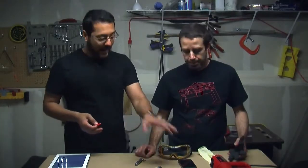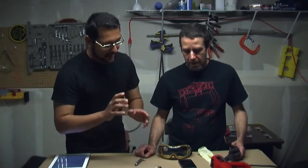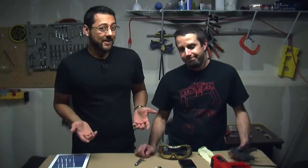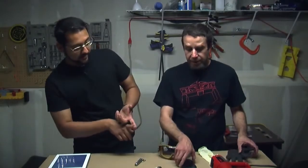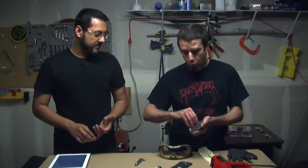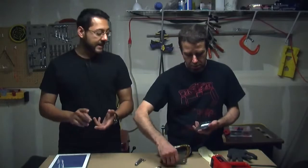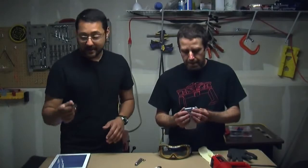If you're going to try this at home, be aware that you might destroy your phone, so back it up — we've shown how to do that in a previous episode. If Burke puts the heat gun on long enough to melt the logic board, he's out of luck. Before starting, make sure to remove the battery — it'll explode when heated. Take out your SIM card and micro SD card too. When we heat this thing up, we don't want any of those elements heated.